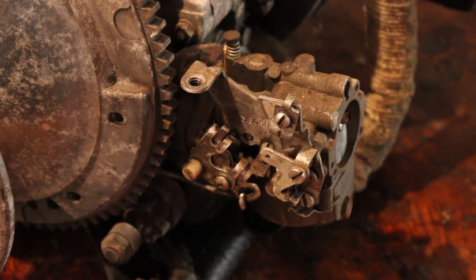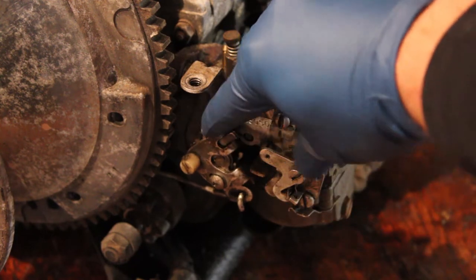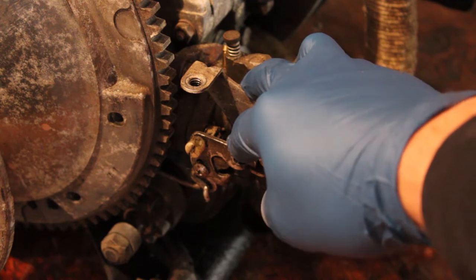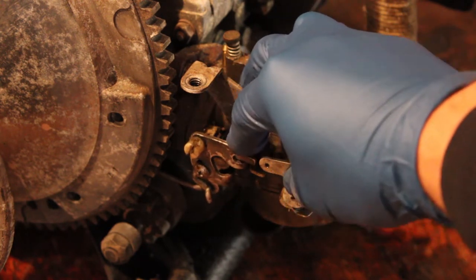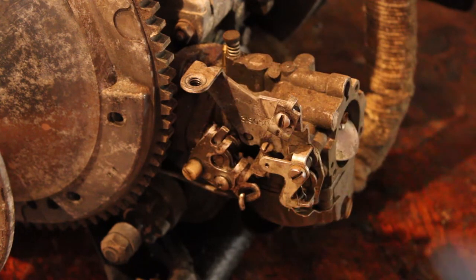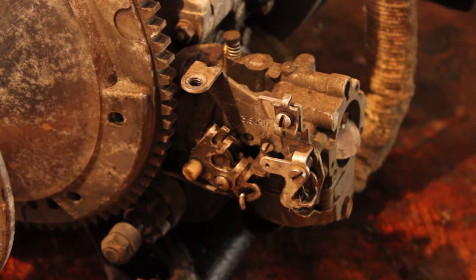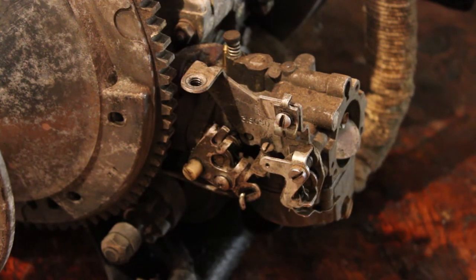I want to give you a good view of how this secondary air valve thing works. From the throttle lever, there's a linkage that goes down to the valve on the bottom. It's literally what it's named — secondary air. As your throttle increases, it opens up and allows more air to enter the engine. But from what I'm reading from guys with more experience, that valve is completely useless and doesn't affect performance at all, so it's better to just go ahead and plug it up to avoid the risk of blowing up the engine. There's a spacer between the engine and the carb with four different nuts, studs, and bolts, and I can't get to one side because the lever assembly is in the way.